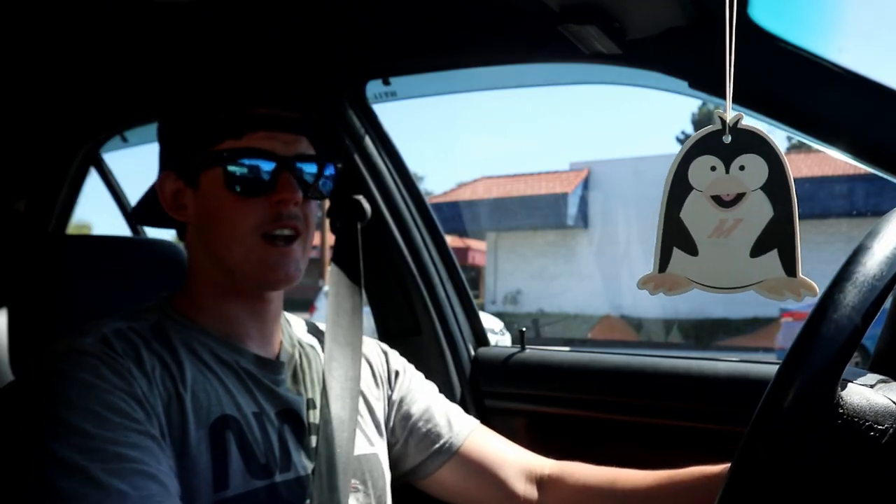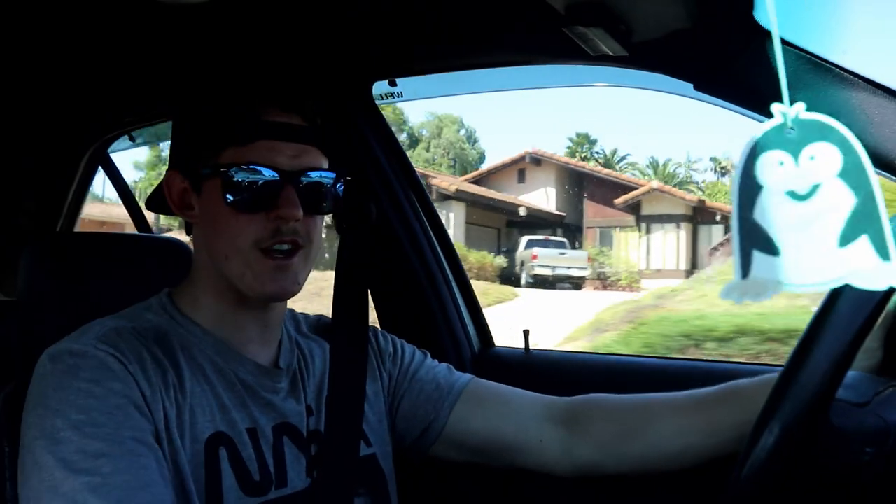If you want more traction in the rear, you can soften the rear or stiffen the front. If you need more front grip, stiffen the rear and soften the front. For street cars it comes down to personal preference — find what's best, and at the track tire pressures will come into play for grip bias. You just have to play with the setup and figure out what works for you. Good luck with your coilover install and setup. If you have any questions, let me know in the comments below. Thanks for watching — keep it fresh, and I'll see you guys later.